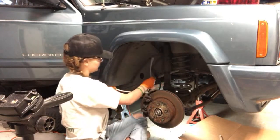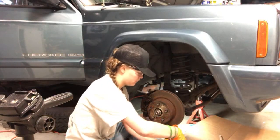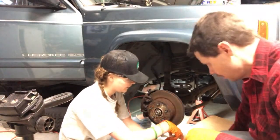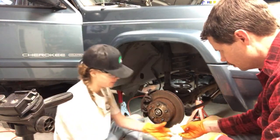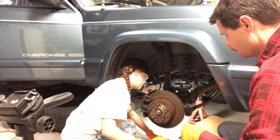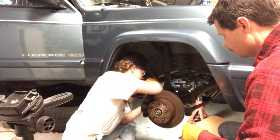All right. Master cylinder looks good, topped off. It's mainly just that back one that bled a lot, the one that had a lot of air. Yeah, these others actually look pretty good. Oh, never mind. We are dripping. From where? The valve. Oh, it's not closed tight? No. It's dripping out of the valve? Yeah. Let me try closing it tighter.